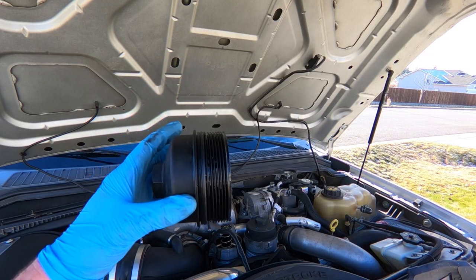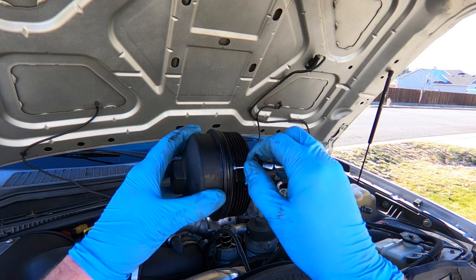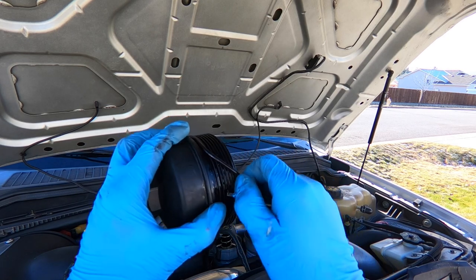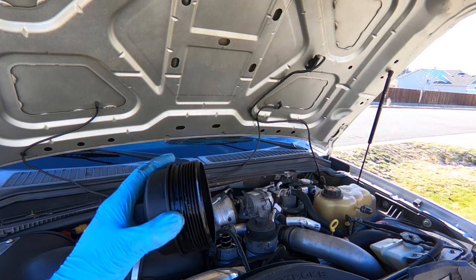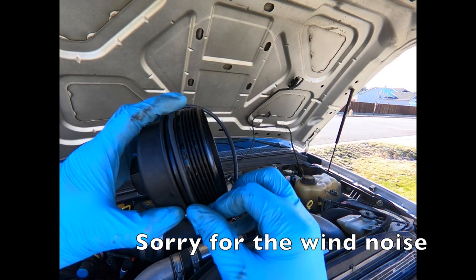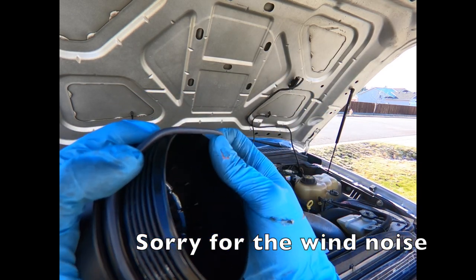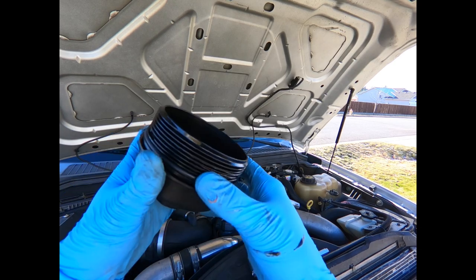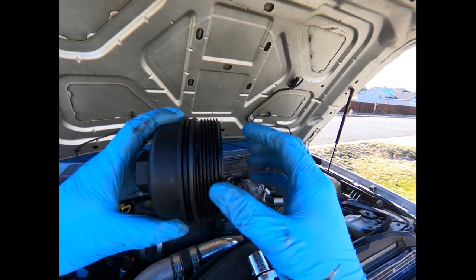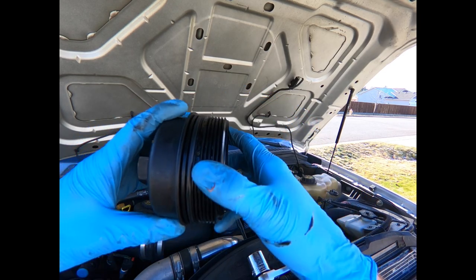Here is your new O-ring that comes with your new filter, and this is the filter cap. You want to take a little tool, pry up on the existing O-ring, and just pull that off, throw that one away and get your new one installed. We're gonna throw our new seal in — just stretch it around, get it into the groove all the way around there.